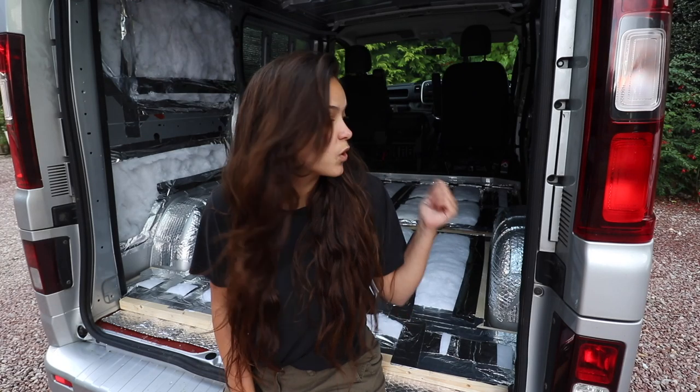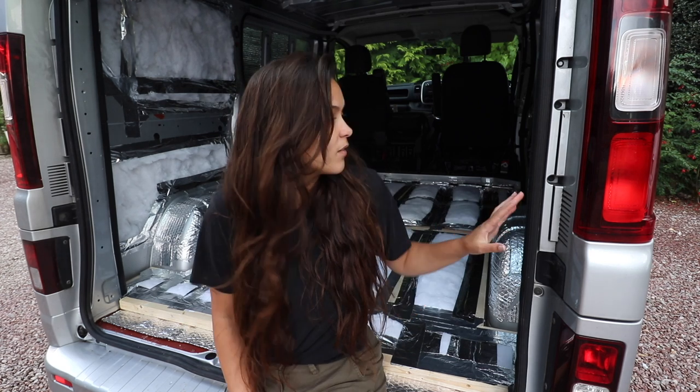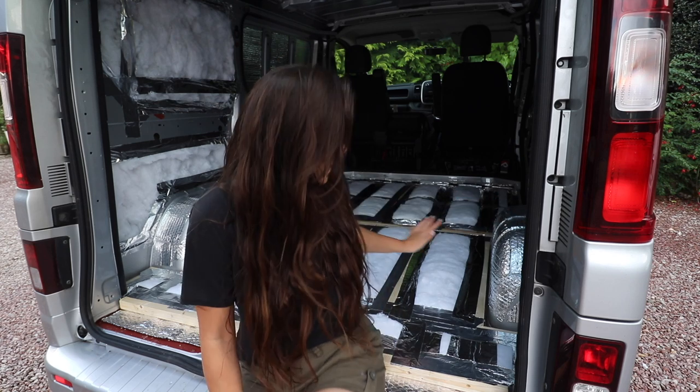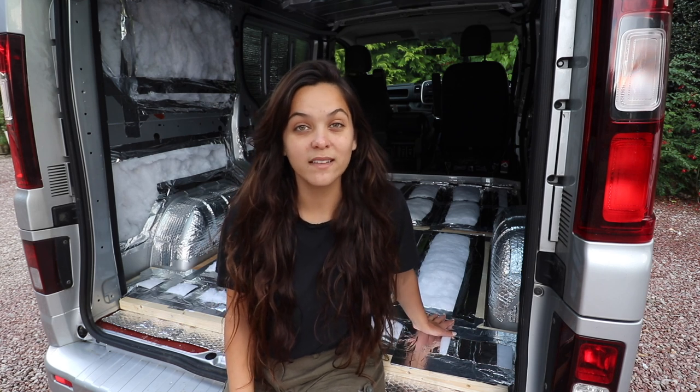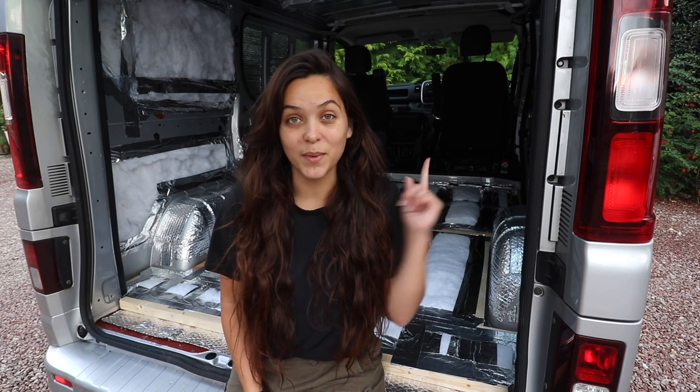As you can see, I've done some work off camera. This is because it has been raining the last few days so I've been doing bits on the inside which include insulation and some sound deadening on the ceiling. I'm really pleased with the insulation I've been using. It is some fleece made by a company called Dodo who actually make it out of recycled plastic bottles. So the next step for me is to get the plywood and put it on top of this, so I'm about to do that now.